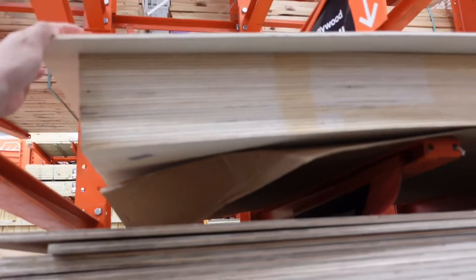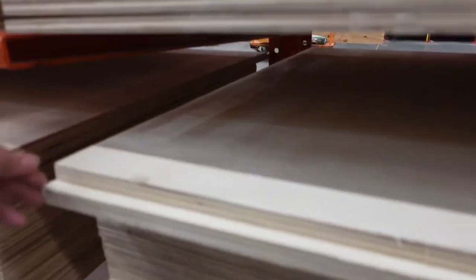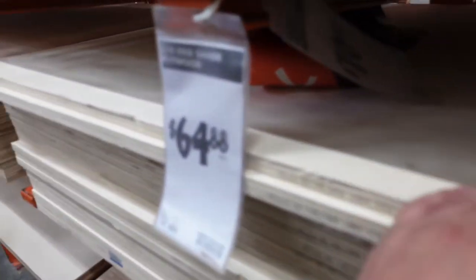Compared to the MDF, man, I think it's heavy — you're going to need two people to carry that. So this one is good. I like this one for paneling. This one's good if you have contour consoles; instead of doing a fiberglass top, you can use this one, and it's bendable to make a nice curve. The half inch looks pretty good, but it is a little bit more pricey. This three-quarters right here — $64, which is $10 more than what the three-quarter-inch MDF would be. But it's sanded plywood.